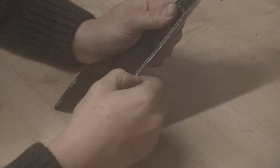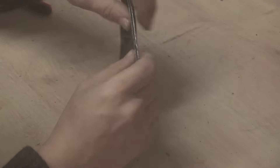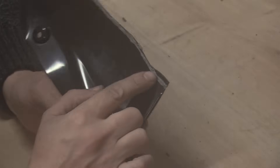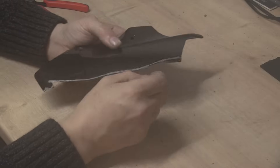Generally speaking, things don't completely break off — they just have a crack in them. This is in two pieces because there's a bit where it chipped out and there's a hole. What's quite interesting is this section here — that section did not break where the weld was. That broke elsewhere; if you look on both sides, that isn't where I welded. So if we V'd this out a bit, and depending on thickness, and spent real time on it — what I'm doing here is just introducing people to the idea, not doing the full repair.